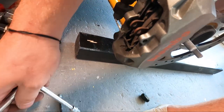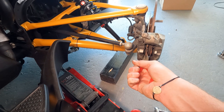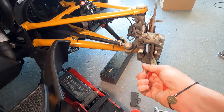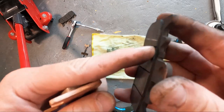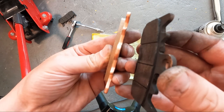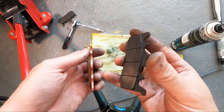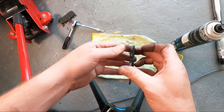Now let's remove it. The next thing — just pull the brake pads out. That's what I've got here. Looking at the old brake pad — I think it's still good for about 5,000 kilometers. Have a look at the difference. The reason we're changing it now is because the bike has brand new oil and everything, and it would be a pain to come back in 5,000 kilometers just to change brake pads.